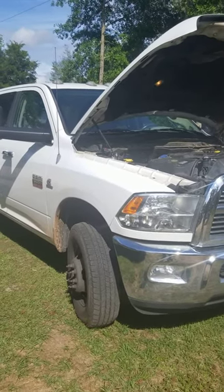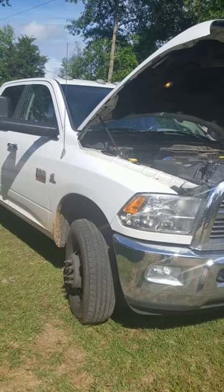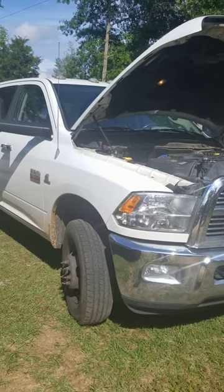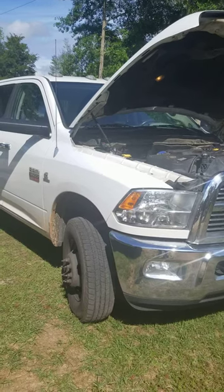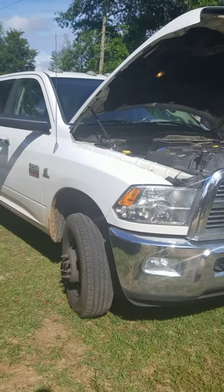This one's got the delete kits on it. It also has a brand new radiator been put in it with a radiator cap. I did the head gasket check on it — it passed, but it was bubbling air. Couldn't figure that out.